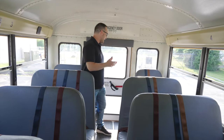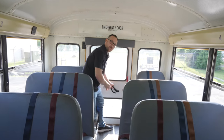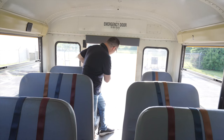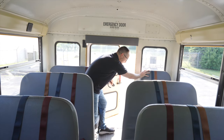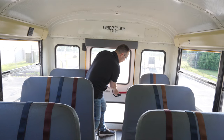Next, I want to check at least one of the emergency exits on the bus. The one that I will check today will be the emergency door on the back of the bus. I have to check to make sure the door opens freely, opens all the way, closes and locks back up. I will pull up on the release arm, which is the red bar. It did release and unlock the door. Now I am going to push the door open, but I have to make sure to secure myself so I don't fall out of the bus while I am doing this. The door opens all the way. The hinges on the door, they are not broken, not cracked, on secure. The door opened easily. Now I have to shut the door and make sure I don't fall out of the bus while I am doing this test on the emergency door. The door did close properly and now I will lock it back up and make sure that locking lever and mechanism work, which they do.